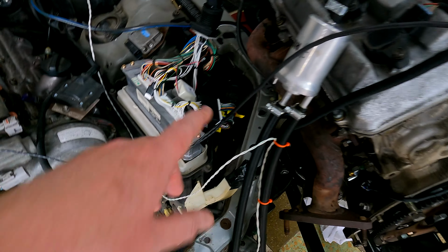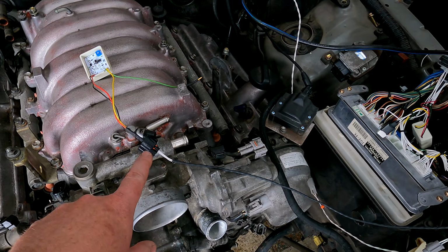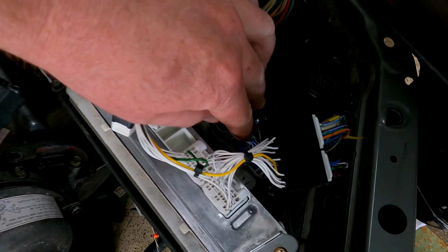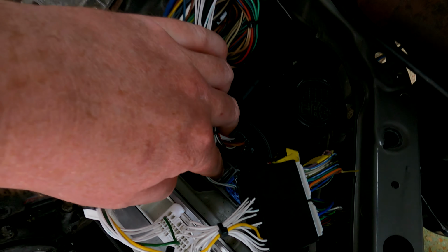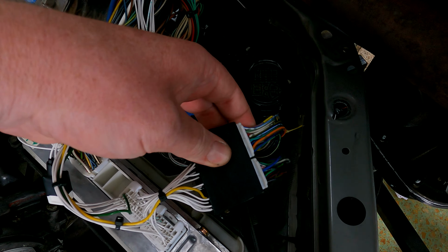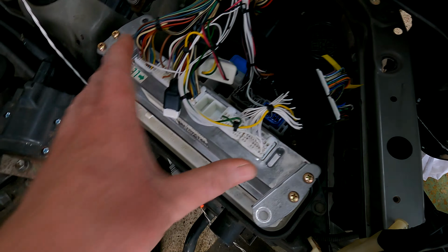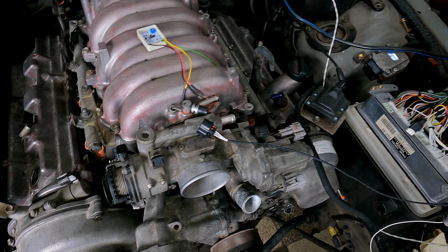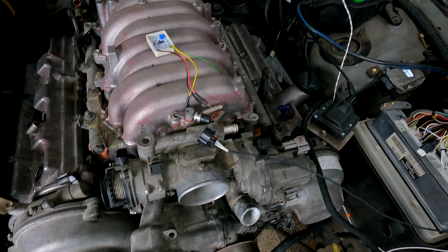So yeah, it should be literally a case of bolt on your harness, get your gearbox section on, there's your reverse, there's your speeds, plug that all in, plug everything in here. So you've literally only got your three plugs there, your black, your gray, and your blue. You've got your 2 plugs from the existing IS200 going into there, plug your ECU in, and literally fire up from the key. And that's it. And everything else should work as per normal.